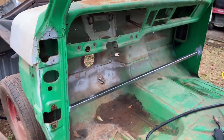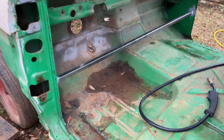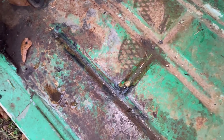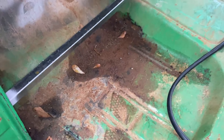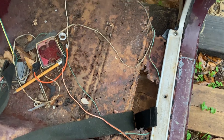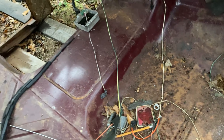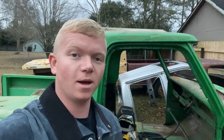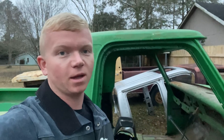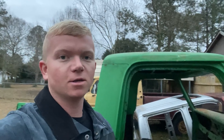Now that I've got some little tacks welded up on that, I don't want to overdo it — I think that'll help keep it from flexing. This will keep it from going down and the weld should hold it from flexing up. I'm not going to have much strength on this back portion here because I don't really have any good place to put a brace — this is already pretty structurally sound. I might have some wobbly rocker panels, but I'm going to live with that. I'm going to go ahead and start working on cutting this floor out now that she's all braced up.